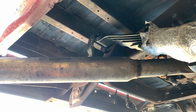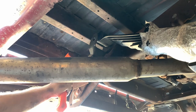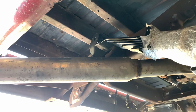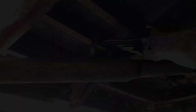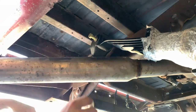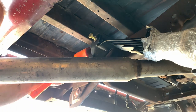With the front mounting point secure, the back will be a whole lot easier. Start by using a mallet to tap the shackle to point it directly at the hole on the spring for the leaf bolt. Then you can use the floor jack to adjust the height of the spring by raising or lowering it so that the hole better aligns to the shackle. From there, continue to use any of the implements necessary to close the distance between the shackle and the leaf spring until you can start your bolt. Once you're able to start the bolt, continue to use the hammer and pry bars as necessary to align the back side of the spring before tapping it through — you don't want to damage the threads by hammering too hard too early.